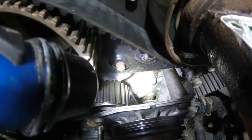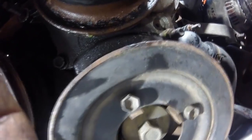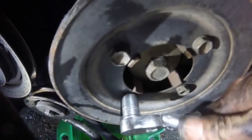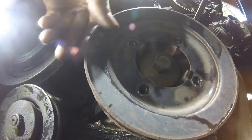We'll inspect the water pump a little bit closer once we get there, but look for signs of leaking — if it's leaking, go ahead and replace it when you're doing the timing belt. You'll also have a crankshaft seal behind the crank pulley. The next thing we're going to do is remove the outer pulley on the crankshaft — use a pretty hard jerking force to break these bolts loose so it doesn't turn the crank pulley too much. I can use a screwdriver or pry bar to pry this pulley away.